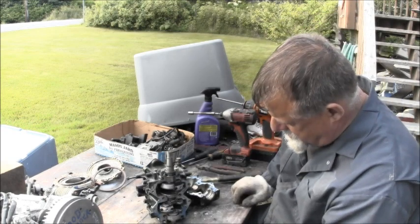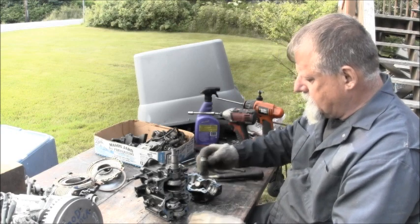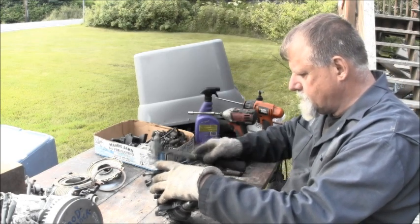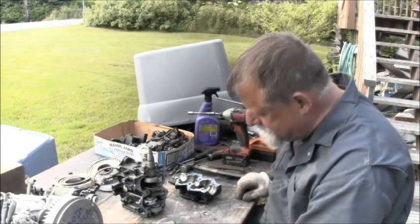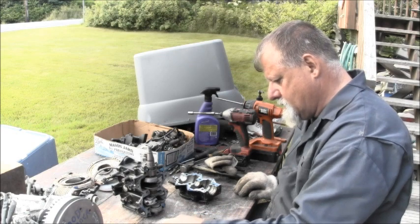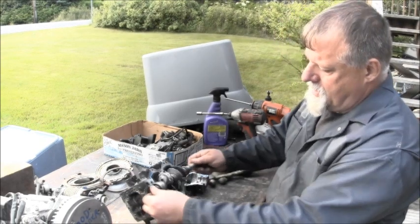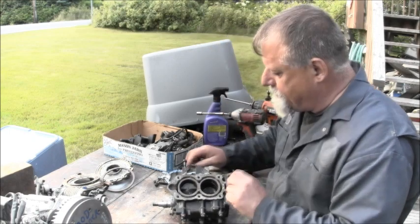Except all the needle bearings on the center bearing are going to fall out, because the cap stuck in there, so we want to make sure we get all of them. Boy, there's still a little bit of salt in there. Let me get them. Get me a little baggie. It's not near as bad as I thought it would be. It ain't near as rusted in the lower end as I thought it would be. Gosh, I just don't know if I could hone that up though.